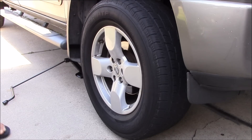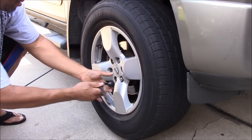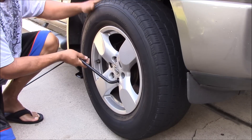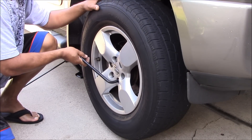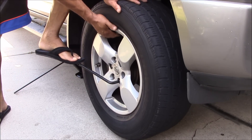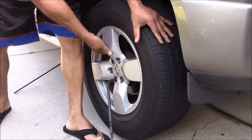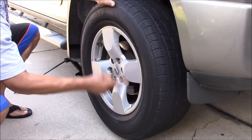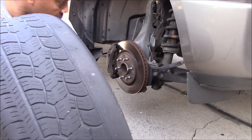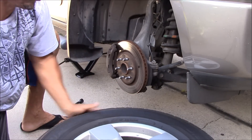I'm gonna get the wheel off the floor. Remove your lug nuts — it's difficult and that's why you want to kind of loosen them before you bring your tire up. It's just me alone so let's see if we can break it loose here. Now we're gonna remove this and take the tire and push it underneath the truck.